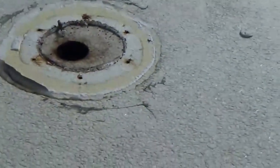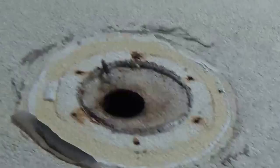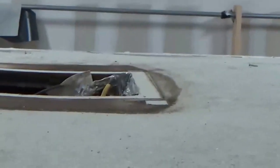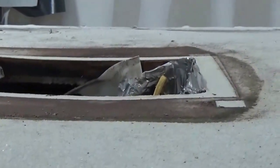we're going to show you up on the top here. Get up on this ladder. This has a fiberglass roof on it, and everybody thinks it's the actual roofing, like one solid piece. You would never think that this fiberglass roof would leak, but because there's no curves, you had water getting in there. You can see some of the rust. The air conditioners failed pretty bad. There's an actual pocket where it's sinking down. I don't know if you can see that or not, but it was puckered. When you put the air conditioner on it, you see that one looks like it's kind of crooked and bent in, sagged.